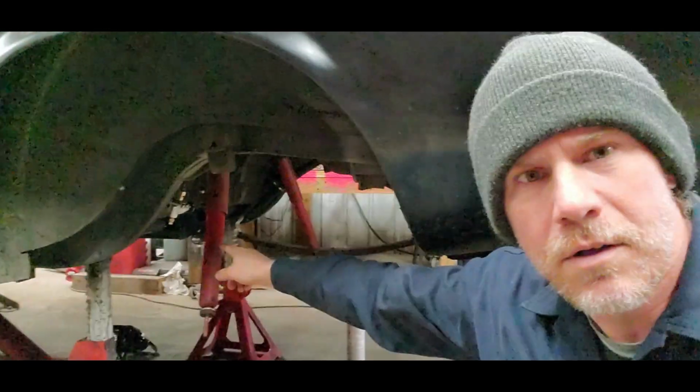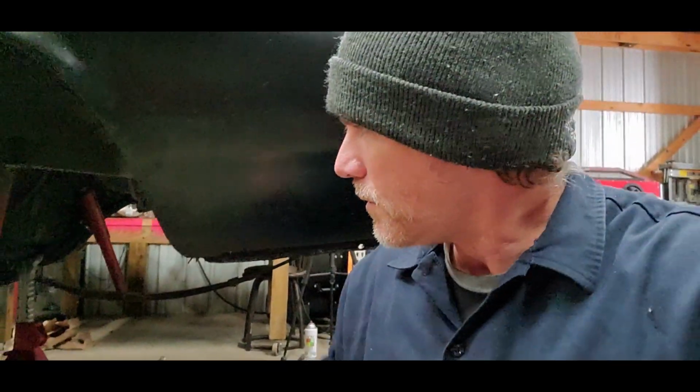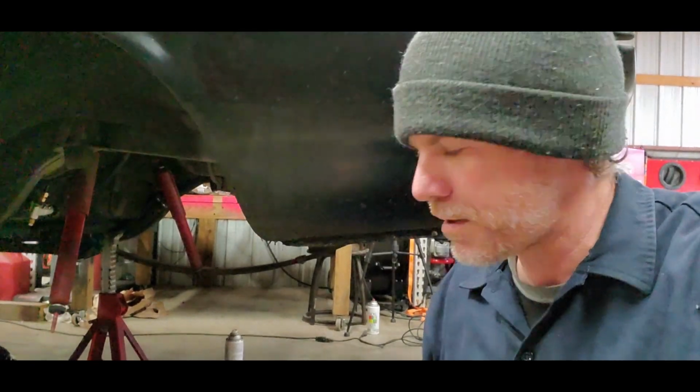Okay, so we got our valve installed up there. It's out of the way, that way we don't have to worry about doing that after we put the housing in. That's ready to go. All you got to do after that is put the line up over the housing, plumb it into our brake calipers, and then hook it up to our proportion valve over there.